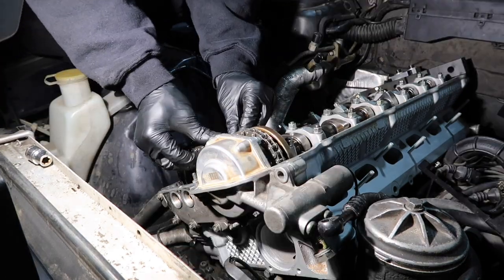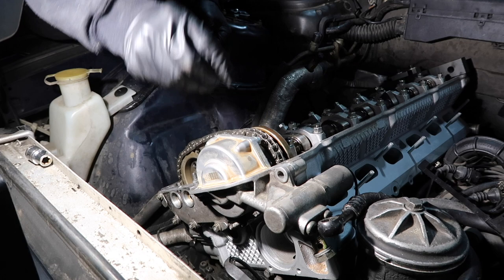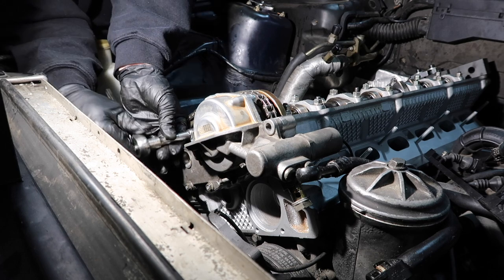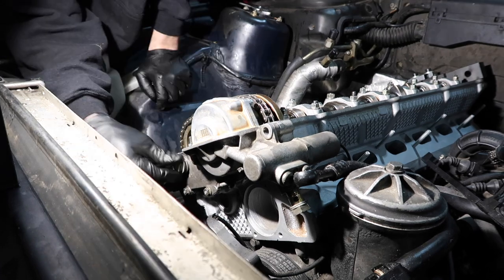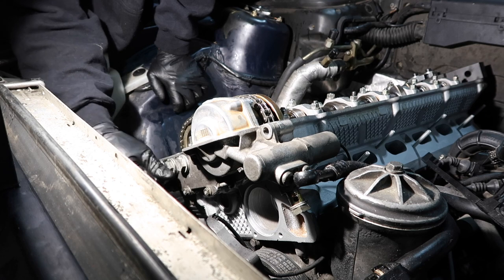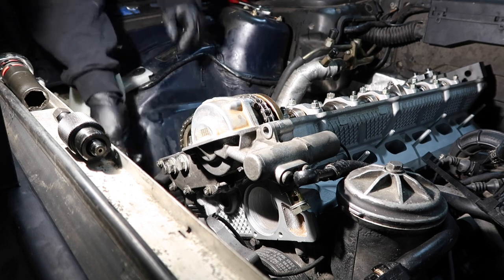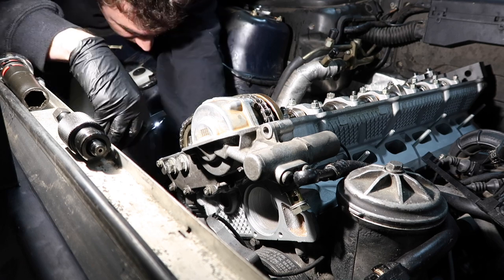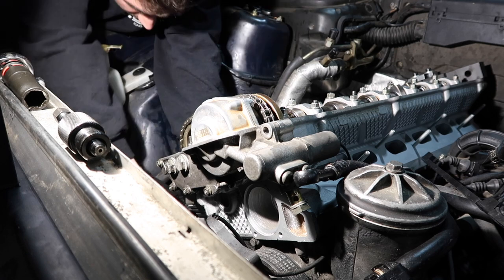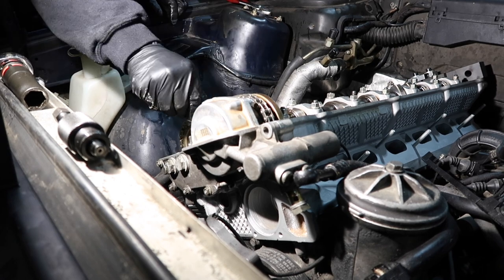Now we can remove the pin that's holding down the tensioner here. Boom. We are all tensioned up. Plugs back in. So there's the dummy. Now here's our real tensioner with a brand new crush washer. There's a slot in it. You want to make sure you get that around the guide, which I have here. All right. Real tensioner is in.